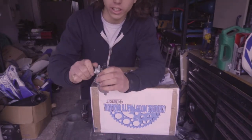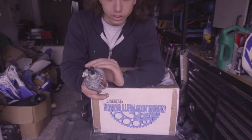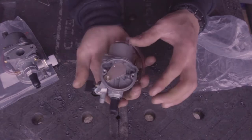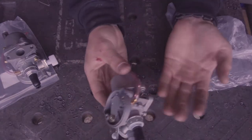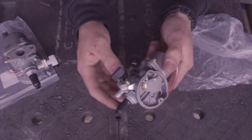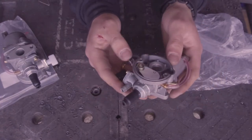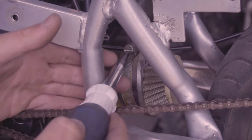The carbs from Chinese Parts Canada are more expensive, but they're high quality and come in a cute little satchel. Anytime you put one of these on the bike, it will start if it's a carburetion issue — it'll start better than it did brand new from the factory. This literally fixes any carburetion problems you'd have with these little two-strokes, because these carbs just get clogged up really easily. So let's slap it on and see how we go.